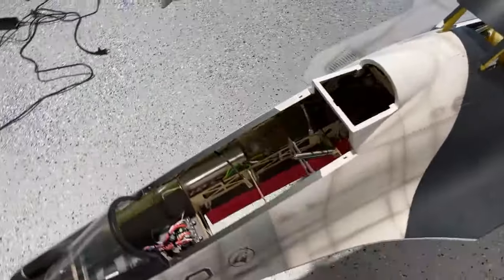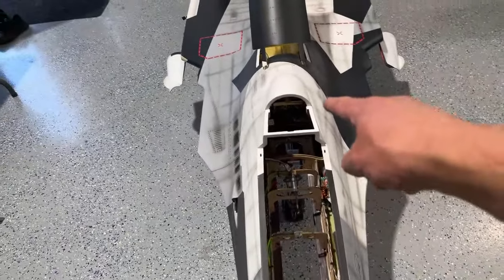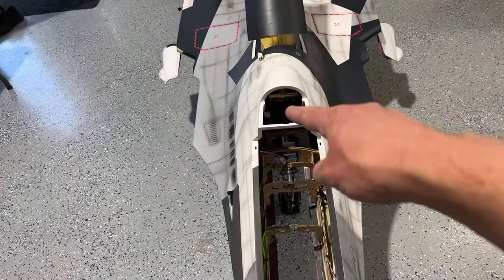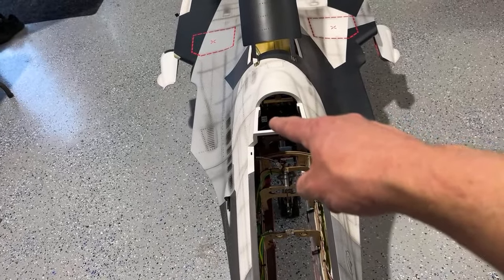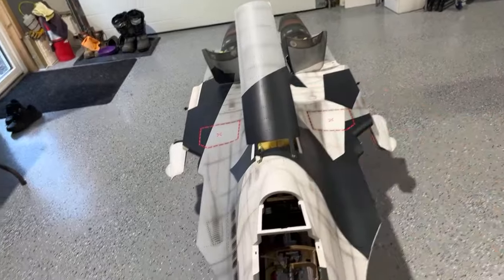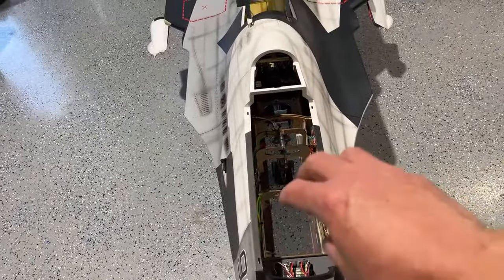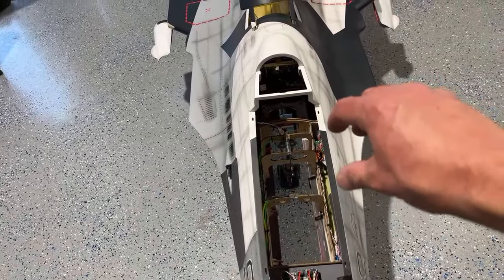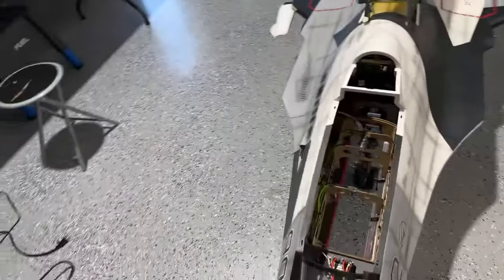And then we have to get our air brake solenoid valve hooked up to our actual air brake. That's got to get done. When we were powering this up earlier, the nose servo was doing something weird. It was like power on, power off, power on, power off. So I just unplugged the servo. I don't know what the servo is doing.